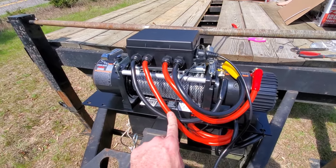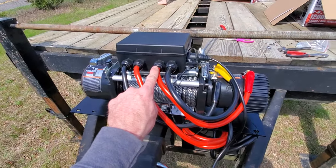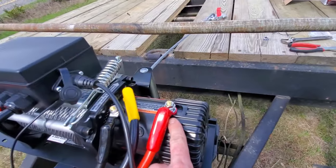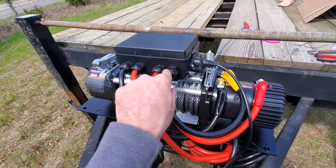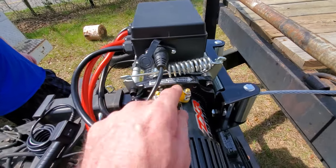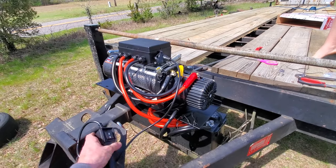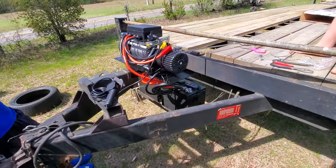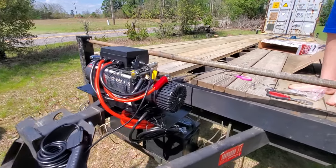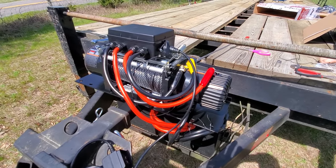The left red wire goes down to the battery. The right red wire goes to the red terminal on the motor, and then this far right black wire goes over to the yellow terminal on the motor. Once you've got it wired up like that, you can hear it — it actually functions like it should. Hope this helps somebody. That's how to wire up a Harbor Freight Badlands 12,000 pound winch. Everybody have a great day — subscribe, like, comment if you like, and have a good one.